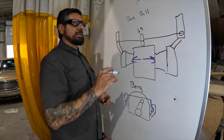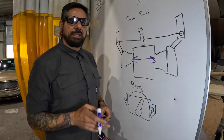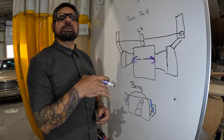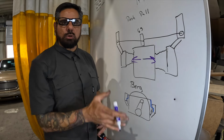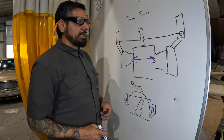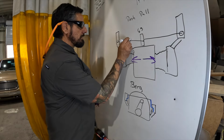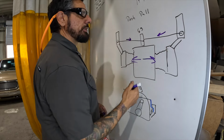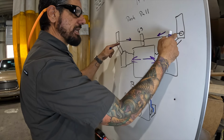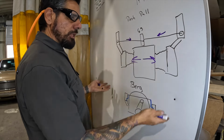So once again, any adjustment you're going to do on a carburetor is going to be done at operating temperature. But operating temperature is one thing, and road tripping temperature is another, because operating temperature is where you'd like to stay. Unfortunately, sometimes we're hitting big grades, or long runs where we're holding 75, 80 miles an hour. That motor's going to get a little warmer than normal. When it gets to a level where this thing really goes to full expansion, these arms are actually pulling in now. The reason for that is they've expanded. Nothing expanded here, so it cannot change that. So that arm moves, which allows it to come inward, increasing your idle.